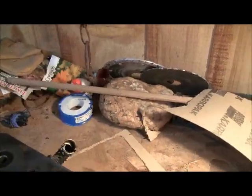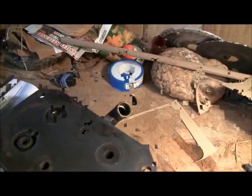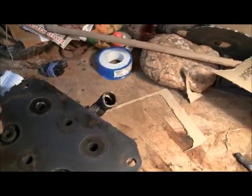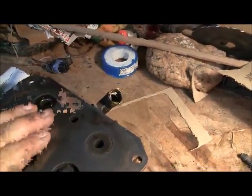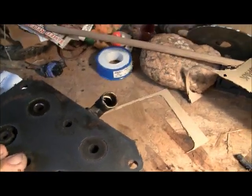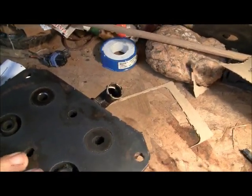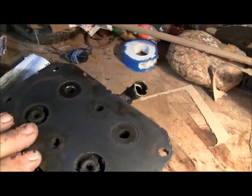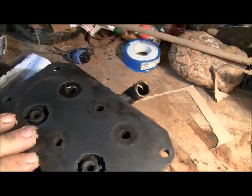Do not use a wire brush. They make little plastic brushes you can put on a die grinder to clean it up — the plastic does pretty good, different grits. When I worked in a machine shop we had them and they did alright, but nothing worked as good as sandpaper. 80 grit sandpaper is what we kept a supply of.